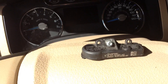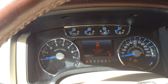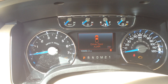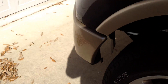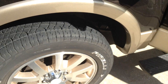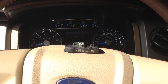Let me show you the emergency flasher method. I'm going to turn on the ignition without starting the truck and then push the flashers on and off three times. You can see the lights blinking — on, off, on, off, on, off — and you should hear a horn honk. There's the honk, and the display says 'train the left front tire.' With the TPMS-19 tool on the rubber sidewall right next to the valve stem, I push the button, get a little red light blinking, and we hear a honk confirming the left front is logged.